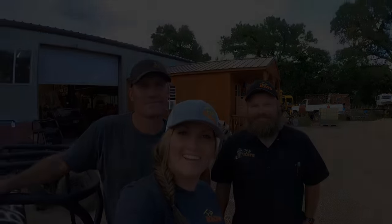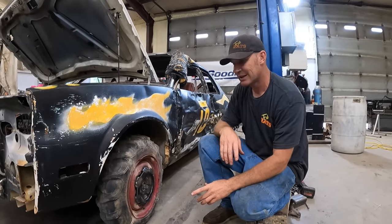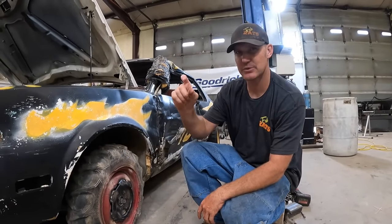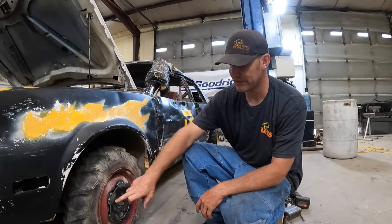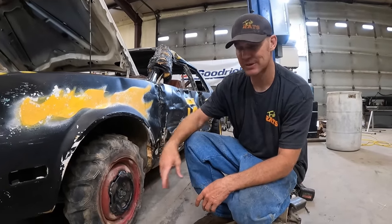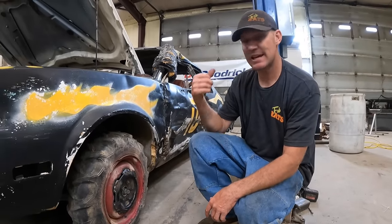All right, so we got the tires all cut out and put back on here. You're probably wondering what the heck we were doing. These tires are made for derbying. They're super thick ply, so they're really thick tires. They don't pop, and they're a pain to put on and off rims. So this is our easiest bet, and it's quicker. We've had like 4 or 5 sets of centers in these wheels already. You just cut them out, weld a new one in it, and you're ready to race. Same with the back. They're super thick forklift tires, and it's just easier to do it that way.